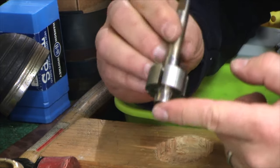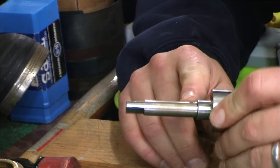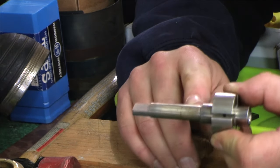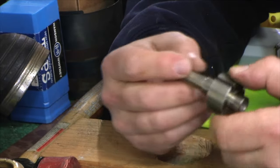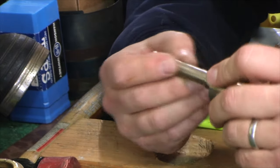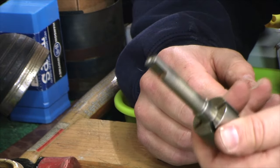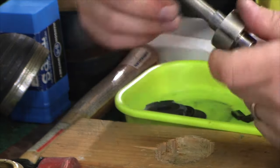It's important to note at this point: if you see a bunch of scoring or gouges on the pump stator that aren't fairly smooth or that wouldn't clean up with 800-grit or better sandpaper, your pump's trash — sort it in the trash and go buy a new one because the seal won't work.